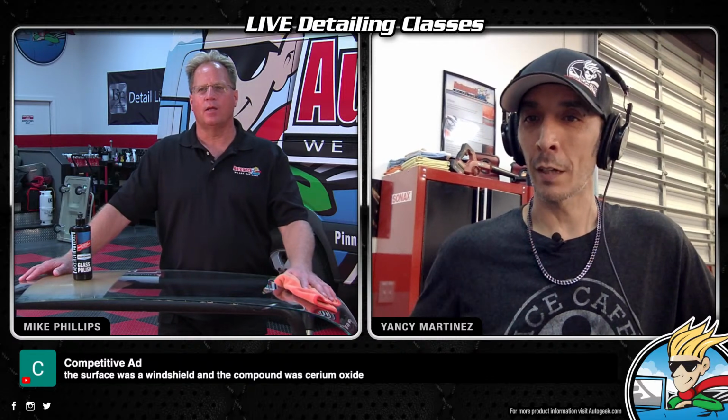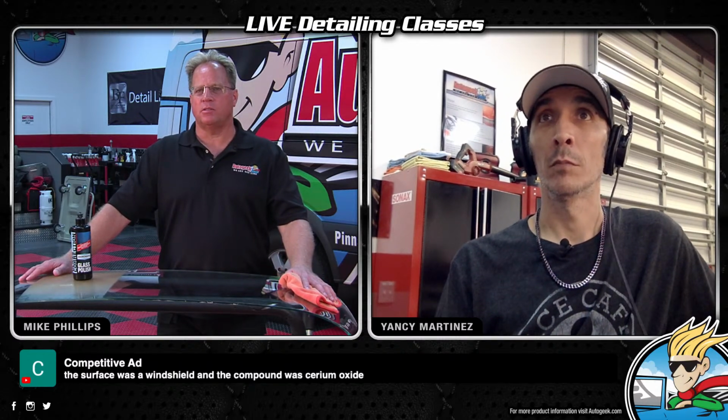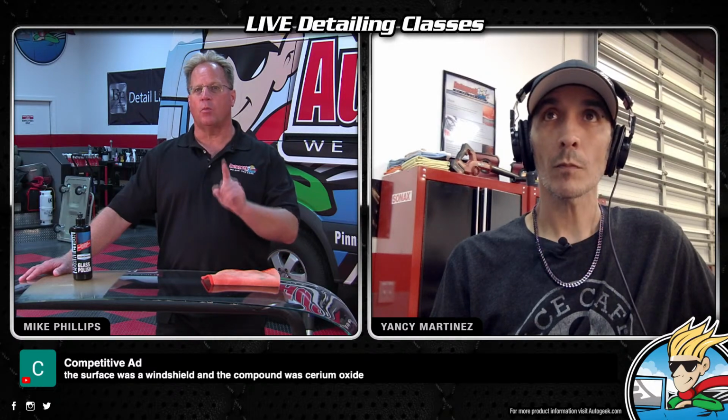Okay, competitive ads coming back on. The surface was the windshield and the compound was cerium oxide, so probably just needed to polish more. Yeah, probably just need to polish more. Here's one thing I'll tell you. You got to make sure everything's clean. Get that car clean, the windshield clean, make sure your pad's clean, and shake that product well.